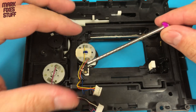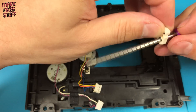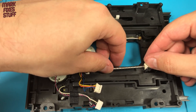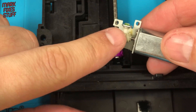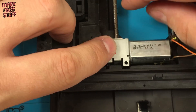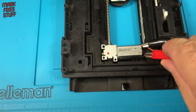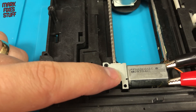Let's do a quick test of the fit and function of our new creation. Right now, I only want to slip the shaft into the mechanism to see how well it fits. We're going to do a test with the motor engaged with the gear. I don't want to use lube yet because it could hide problems, so we're going in dry. I'll hold the motor in place so I can feel if there's any mechanical issues. I certainly can't rotate the shaft anymore. I'm going to connect one of my bench power supplies to the motor and apply a gentle curve up to around 3 volts, whilst keeping an eye on how much current the motor is drawing. Current draw is very low and the gear runs quite smoothly.